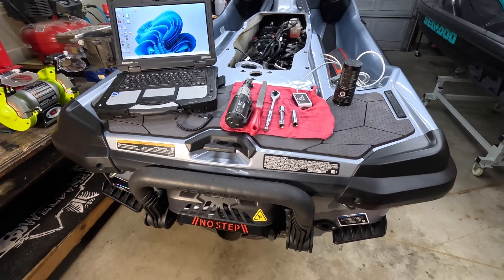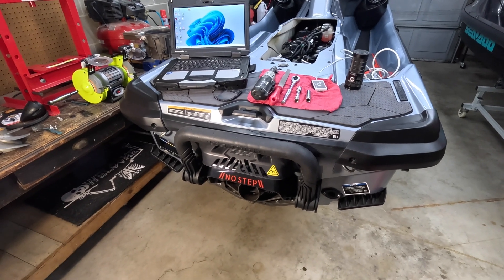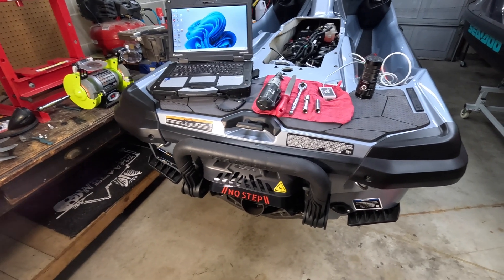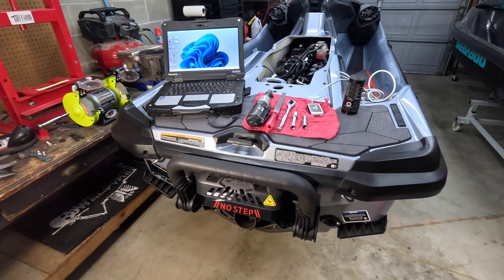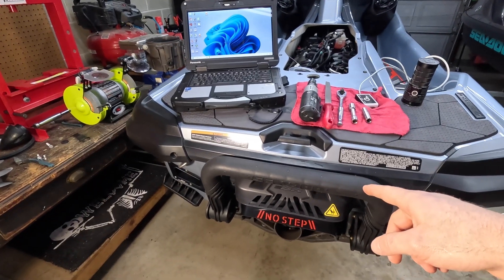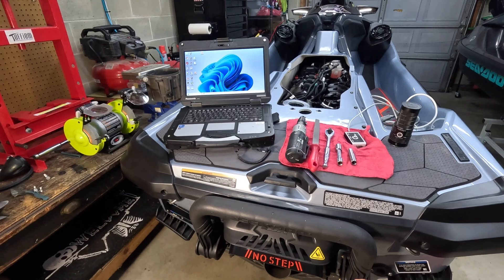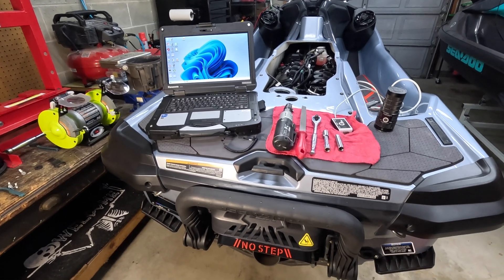In this video, I'm going to show you how to do the IBR stop grind on a late model Sea-Doo C2. This is more prevalent in the 2022 and up models, but it also works on previous year models as well. Essentially what this mod does is give you extended VTS range, but it will also help gain an additional mile per hour or two on the top end. This Sea-Doo had the IBR stops weren't ground down far enough from the factory, so when I did this process, I was able to gain around four miles per hour.